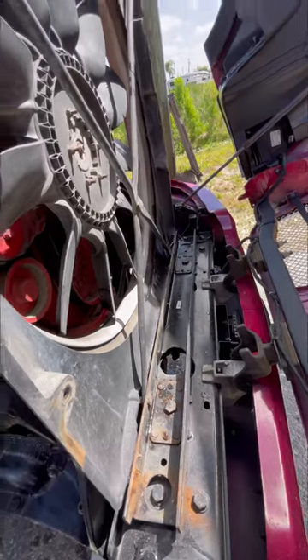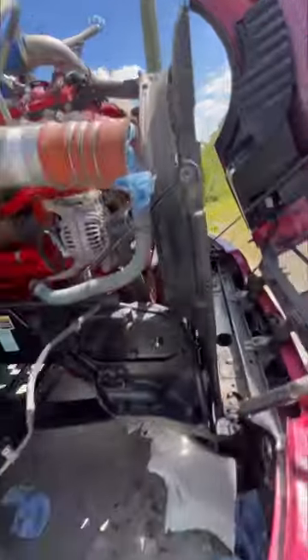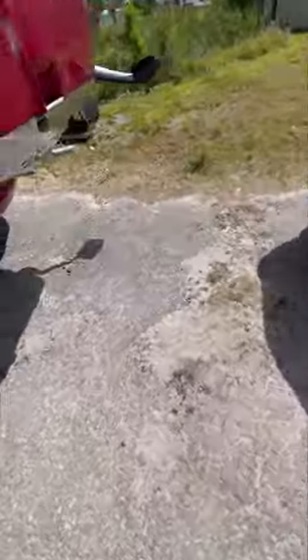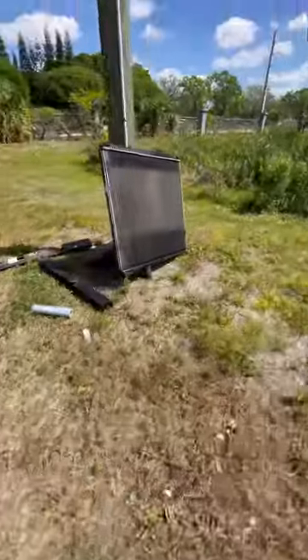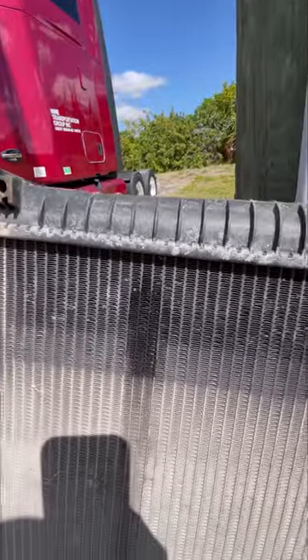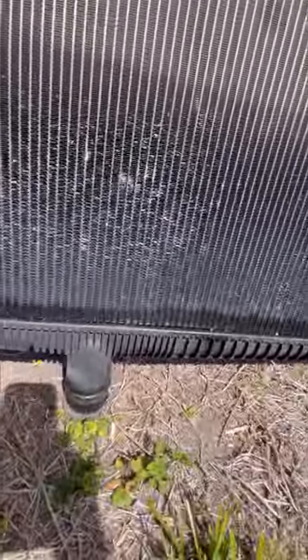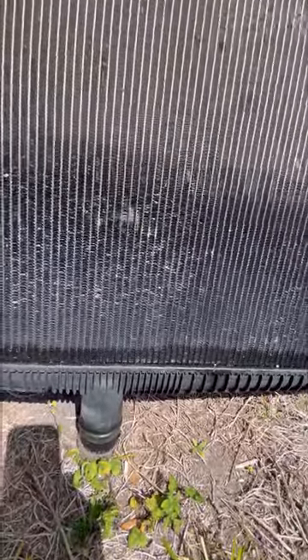For owners with a 2019 or 2021 model, it's very easy to work here. This bottom metal piece — you can actually stand with your feet on it and rest your back against the crossbar, and you can easily pick up the radiator and intercooler yourself. You can see antifreeze everywhere. The leak started somewhere over here — the wet spot ran down and filled the bottom, and that's what was leaking.